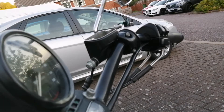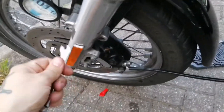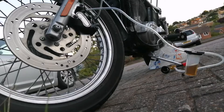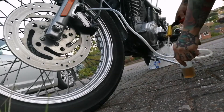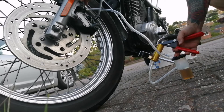So bleeding the brakes is fairly easy — you put your vacuum pump on the nipple, then get a little spanner and undo it, and pump the hose to get the vacuum going. To bleed the excess, get your vacuum pump connected to the caliper bleed nipple and then get an 8mm wrench or spanner.